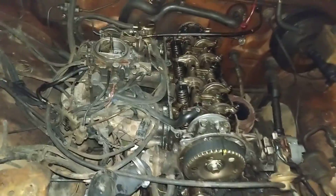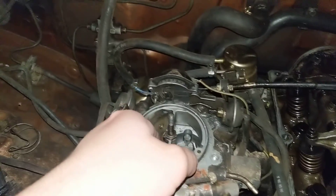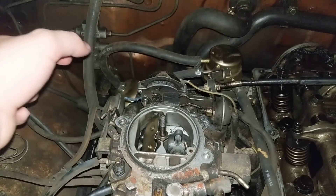I'm going to redo pretty much all this vacuum line stuff. I am keeping this carburetor as long as I can, but things don't seem to be hooked up all the way correctly. The choke should be closed right now and it doesn't close all the way, and it's held together with a wire tie like a bread bag or something like that.